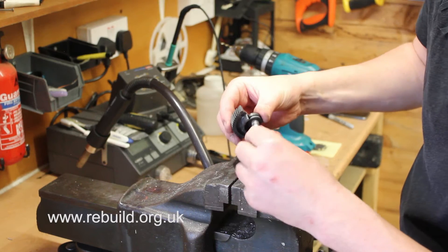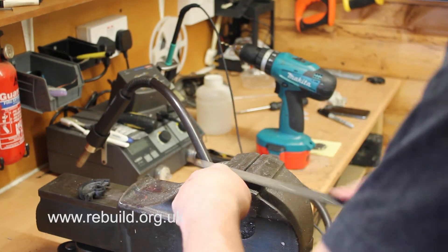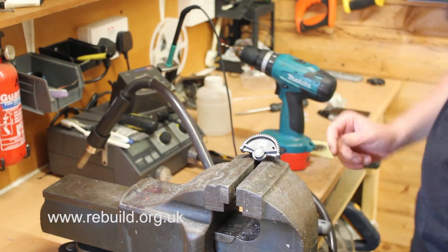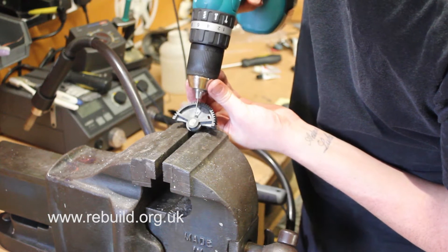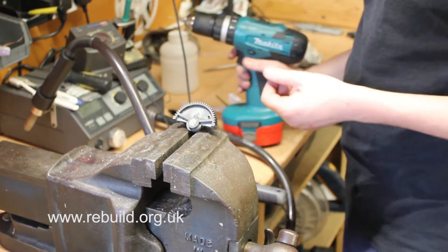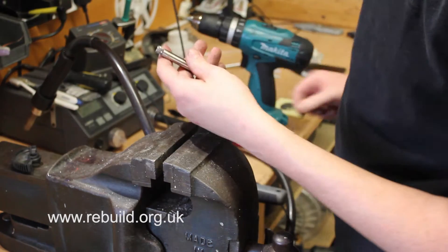You want this to be a tight fit. It's quite important that this is a tight fit — I'm not suggesting you hammer this on, but it should slide in pretty tight. Now I suggest pinning these. So in order to pin the half gear, put it in a vise at this point. Lining it up is quite important. Getting the angle right is also very important. A top tip I'll share is I only drill about 4mm into the shaft and I'm going to finish the rest off by hand.